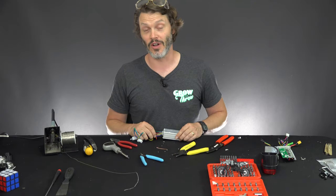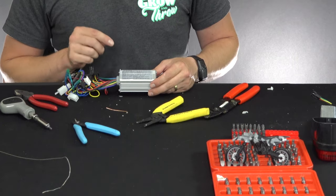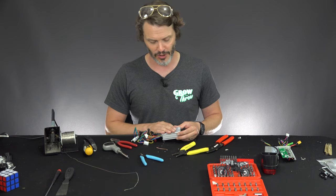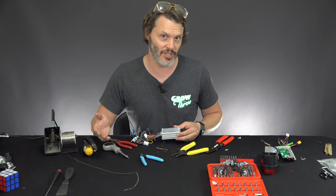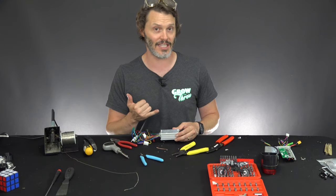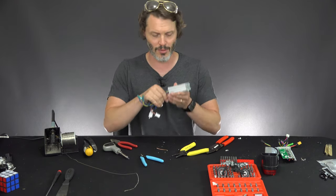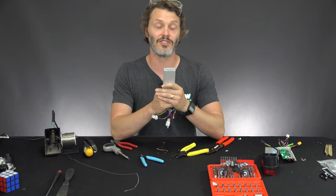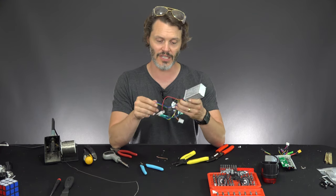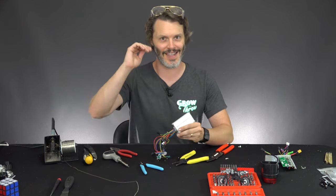There you go — that is the shunt mod on a speed controller, in this case the DYU V1. You can do this shunt mod to any controller, and especially if it's a non-programmable controller you would want to do this. If you can program it, a lot of times you just program in double the amperage — double on the phase side for torque off the line, and on the battery side for high speed. If you're watching this, you probably want more torque, so up those phase amp limits if it is a programmable controller. In this case it was not, so we did the shunt mod, and now it is time to see if there is any more torque — but we've run out of time for today, so we'll save that for the next video. I appreciate you tuning in. Have a good day.